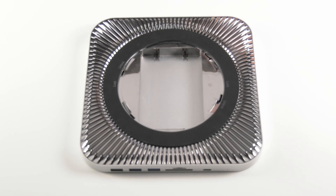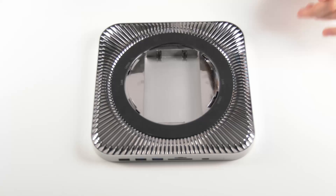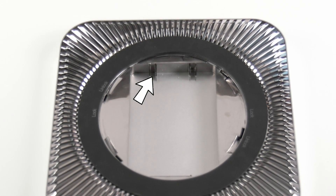When you open this compartment you'll find a SATA port and space for a 2.5-inch hard drive or SSD, so it'd be rude not to try it out. I've purchased this Kioxia 960GB SATA SSD for the purpose — Toshiba renamed their memory division to Kioxia, so this is actually a pretty decent drive. The cheapness of the finish shows itself again during installation because the drive doesn't fit in flush due to these angled plastic standoffs. That said, the drive works fine, the SD card slots work well enough with a nice latching mechanism, and they apparently support cards up to one terabyte in size.